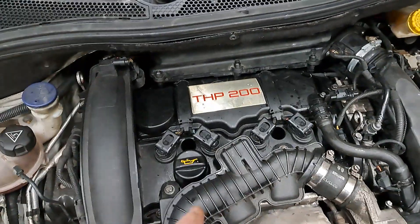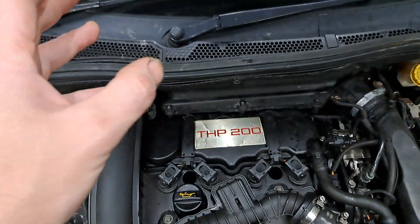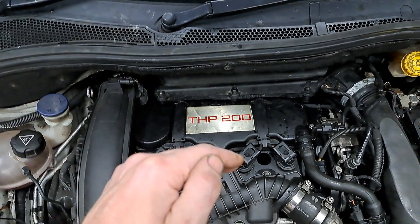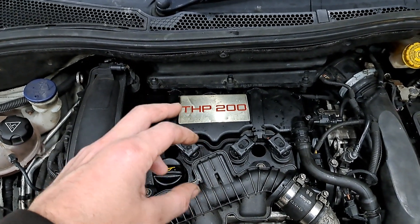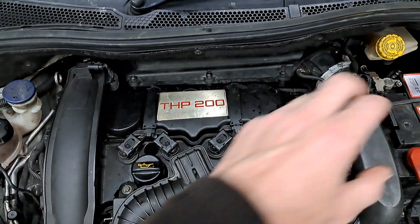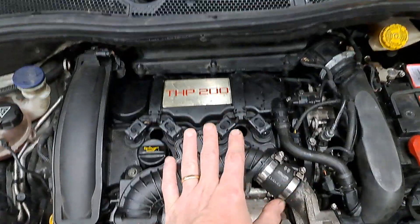The other thing that can be a problem is the intake throttle body and the throttle position sensors. It can be a variation with that, but if you look at throttle position 1 and 2, and then the actual throttle position, you can watch the three graphs — two of them will follow each other perfectly and the other will be a perfect mirror image. That works correctly on this engine.